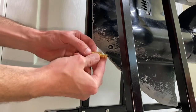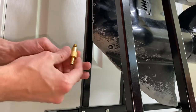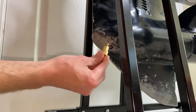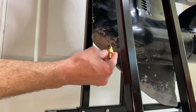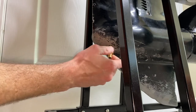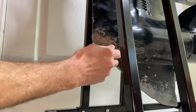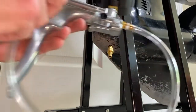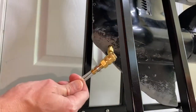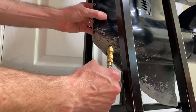Grabbing the fitting — in our case the smallest thread fitting. Do not cross-thread this. Ensure that your rubber O-ring is in place, then carefully align the thread and screw it in just hand tight. Next, grab the entire hand pump pressure test kit and use this fitting — push it until it clicks and locks in place.